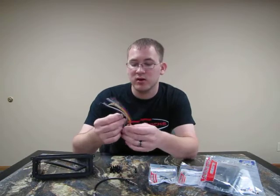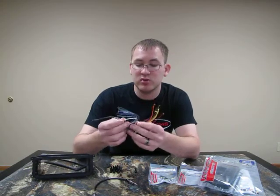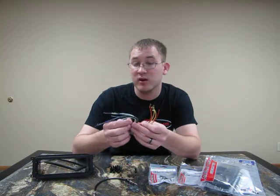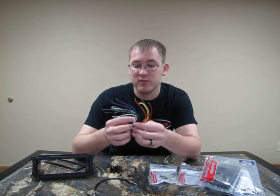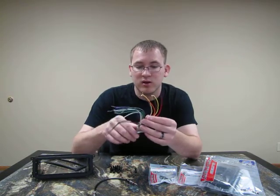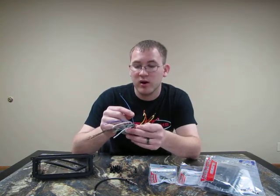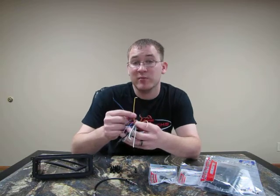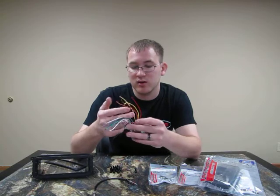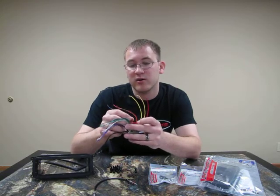You get your radio wiring harness. It comes with two grounds. You get four sets of speaker wires — purple, white, green, and gray — each one with a positive and a negative for each speaker, and they're all color coded. You get the blue remote wire, which is also used for an aftermarket amplifier turn on. And then you get your yellow and red wires, your power and accessory.